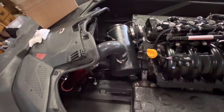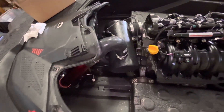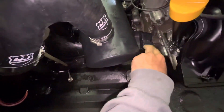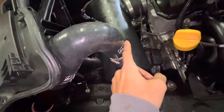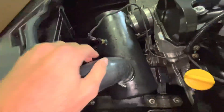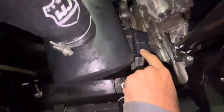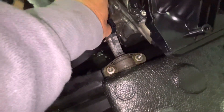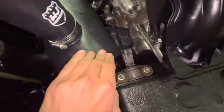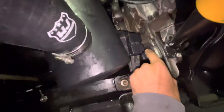I got a straight pipe from all the way to here. This thing is going to be hella loud, I'm kind of nervous about it. But it's super easy to install - I thought there were screws holding it down but no, all it is is this. Once you loosen this and pull it back and take this off, it just comes out - it's just resting on a rubber grommet right there.